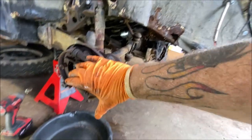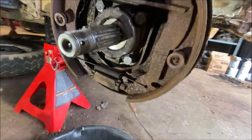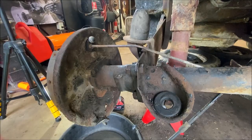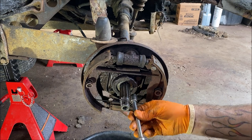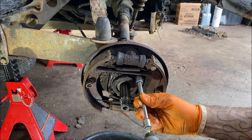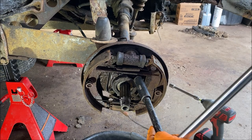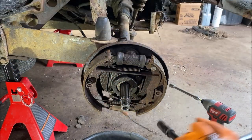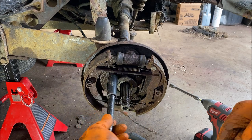You don't have to remove the backing plate — if you just loosen these bolts, the axle will slide back with the whole drum, though you'd still need to disconnect the brake line. But I'm replacing the bearings, seals, everything new so there are no leaks. Before you do that, spray a little PB Blast on the four bolts and also come around the back and spray the threads, so penetrating oil gets on both ends. Remember, this is a swing axle and oil will come out, so put a drain pan underneath. I'm going to use an extension on my impact — these are 14 millimeter bolts.